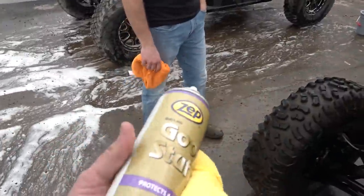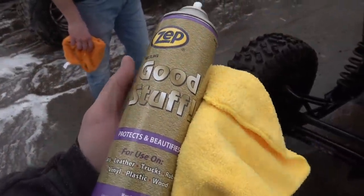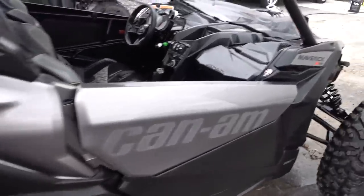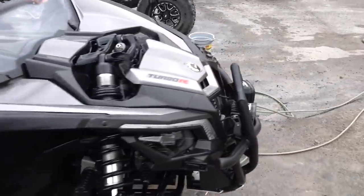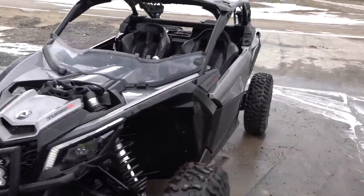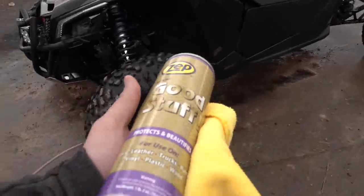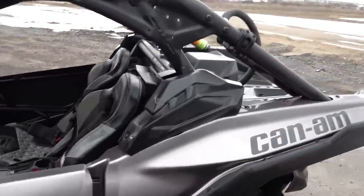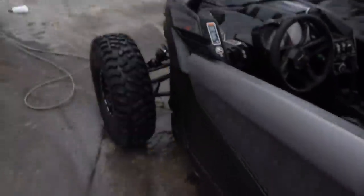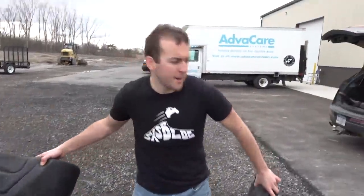I think there is a benefit to using the tighter nozzle — it breaks up some of the mud on the black plastic, which is typically super hard to get off. The last step I'll do, after Rick's done, is cover it in this stuff — Zep Good Stuff. This is a water-based silicone, whereas other silicone stuff like SC1 is typically solvent-based, which can have a bad long-lasting effect on your black plastics. Water-based stuff like Armor All — it's all water-based, that's why it's white. This comes out white too, because it's water-based. I'll spray the whole thing down while it's still partially wet, then dry it with microfibers.